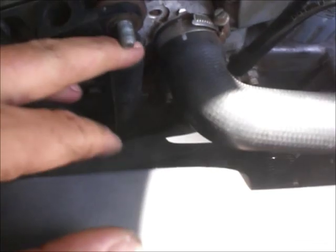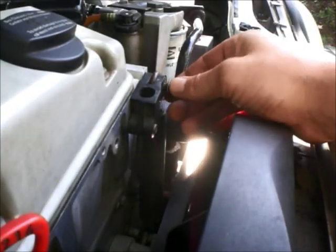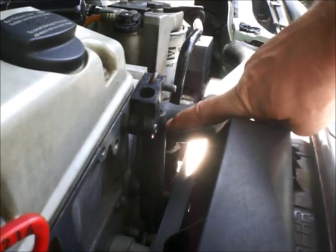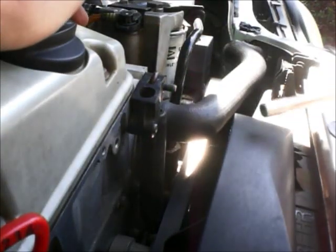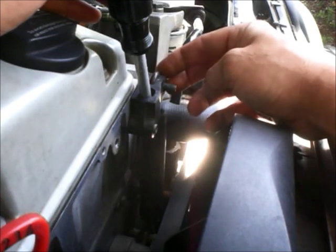I screwed the lower 11-millimeter bolt back to make space for the movement of the tensioner. I will release this spring and see how much movement there is and if there's any way to get it out without removing the whole assembly. The next step: I'll remove this 13-millimeter bolt and try to release the spring to see the movability of the tensioner assembly. To remove this bolt, I need to release the tension from the spring, so I have to pull with something — and the bolt goes nicely out.